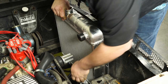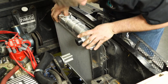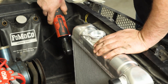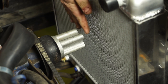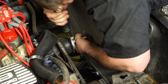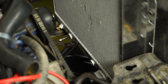With the fan removed, slide your radiator into place and then bolt it down. With the radiator in place, we can see that the fan is too close with this spacer. We sell multiple spacers here at CJ's, so get the right spacer for the length between the radiator and the water pump pulley. I removed the two trans fittings off the original radiator — just get them removed, put some new sealant on them, and put them into the new radiator, then carefully tighten them down.